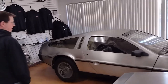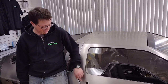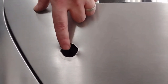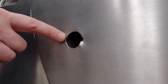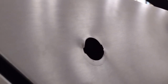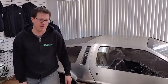This is kind of what not to do. You can convert a two key car to a one key car — from Texas you can buy a new lock cylinder that will convert your car from two keys to one key. You have to make a slight modification in the door: the two-key car notches are at three and nine, while single key cars have a notch at twelve and six, so you have to cut a little notch. What you don't want to do is what happened on this door — whoever did this got abusive and made dents on both sides, pounding to get the clip off. The lock set is available, around $140, and it's a nice upgrade to convert your car so everything matches.